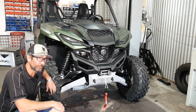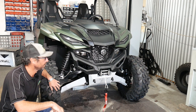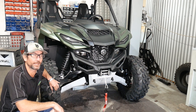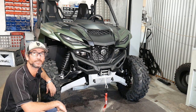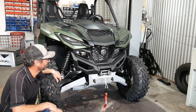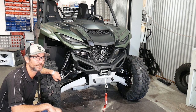Eddie from Aussie Power Sports. I'm back here with our R-Max 2 after fitting the skid plate kit to this machine, and we're going to put our big heavy-duty scrub bar on it next. It consists of the heavy-duty front bar, fender protection and rock sliders. We're going to start with the central part of the bar. The first step is to remove some of the factory stuff so you can get into the chassis and subframe to mount our bar to it.